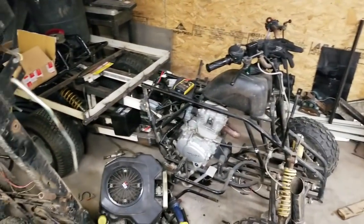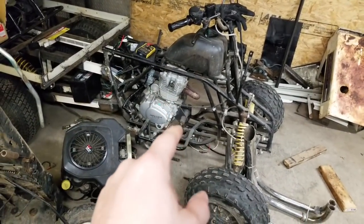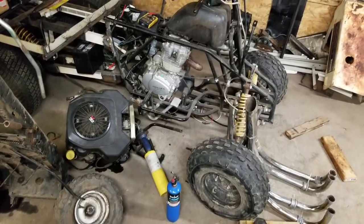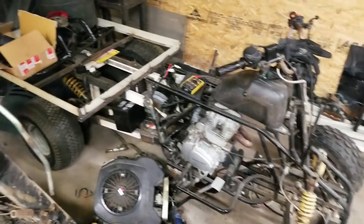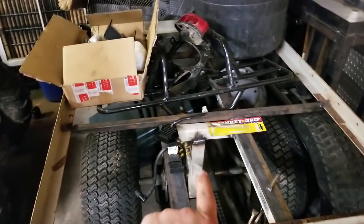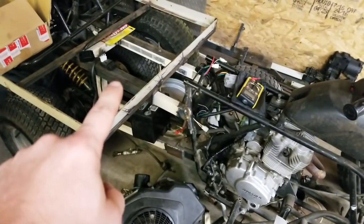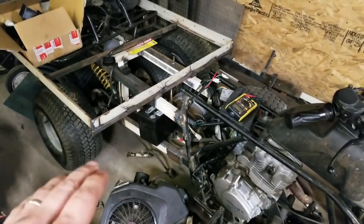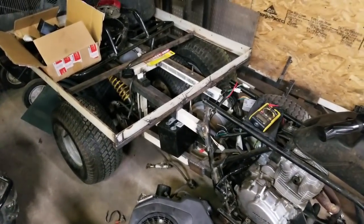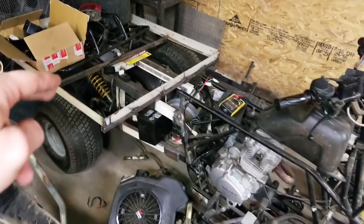The deal with the four-wheeler, which is the one we're gonna be working on today — I figured out the stator is bad, so apparently if your stator ain't working you're not gonna get no fire. What we're gonna do today is put dual shocks on the back. The white bar going up and down right here is connected to the swing arm on the bottom and to the framing for the bed on top. That's not allowing it to have any suspension. I've recently scored a four-wheeler suspension and I'm gonna take the two rear shocks off of it and put both of those back here, so we will have suspension on the four-wheeler.